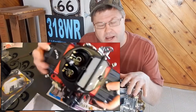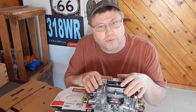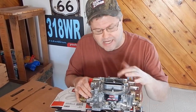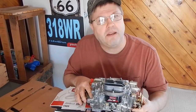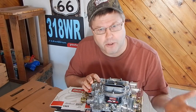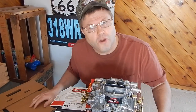Really, my Duster is set up to favor this. It's got such a small cam in it, factory stock torque converter, and highway gears — 3.23s — that really the 650 is probably a great CFM for it. Probably not the double pumper. Most people would say it would favor this carburetor, but it would be really fun to see if the AVS2 could actually outperform the 750 double pumper brawler right at the dragway. Maybe make a couple of passes with the brawler and slap this on and make a couple of passes. Just see — you don't know until you try.